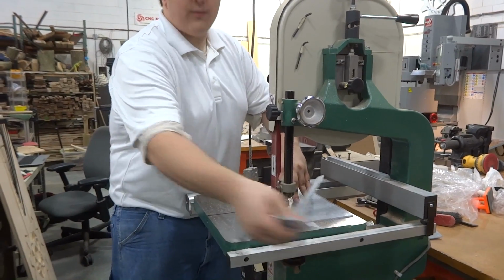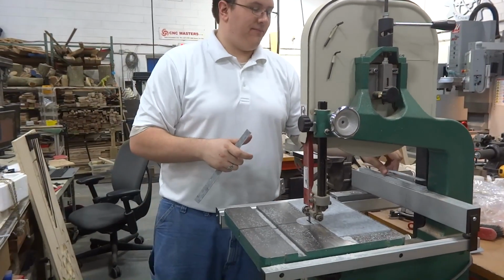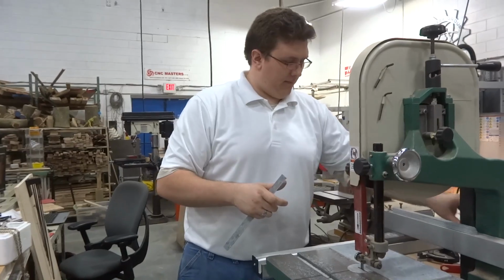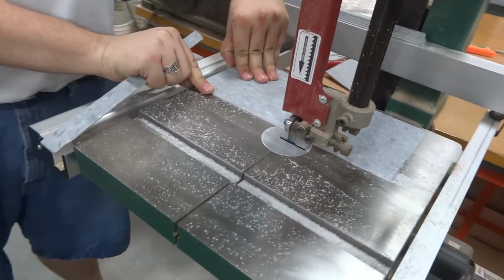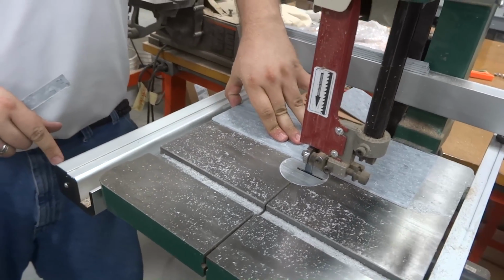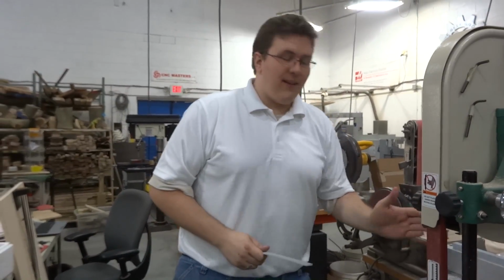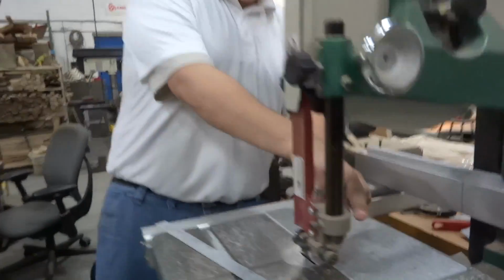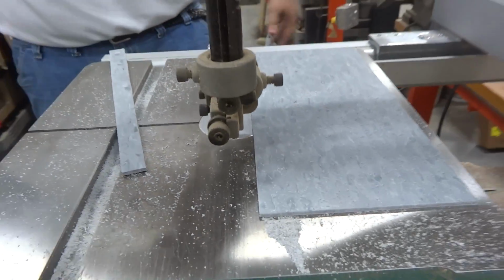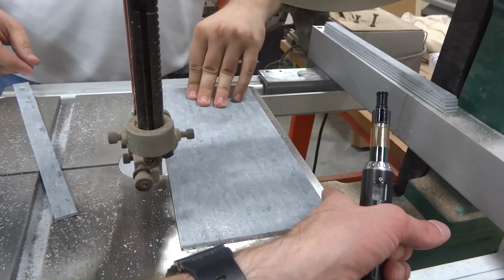Patrick? Yes. Why are you making crooked cuts? Because I'm fitting a crooked wall. Oh, okay. Is there a line scored on there that you're following or something? That's why I'm using this as the template, so it's as close to square as I can. Is it glued down? No, I'm holding it down flush to this edge. Because this, which you would normally use, doesn't get close enough to the blade. That should touch the blade. No, there's this nice little bolt right here. Oh, okay. You know what you do in that event? You use this to hold your parallel here.